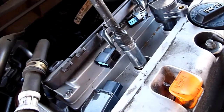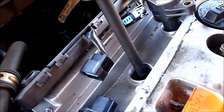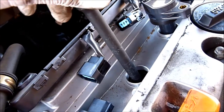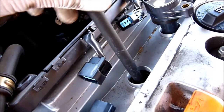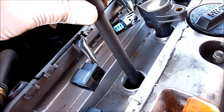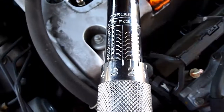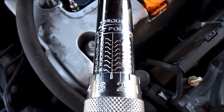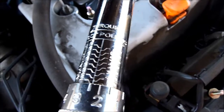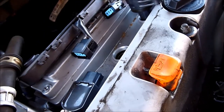Number two — go down, hand screw slowly and straight. No need to be in a hurry. Tighten now — we're going to use the torque wrench. 13 foot-pounds of torque, and a quarter turn after that, after it's clicked. Just a quarter turn after that. Now number two is done. Ready for number three.